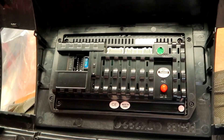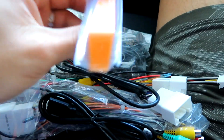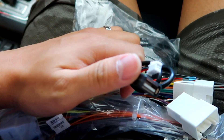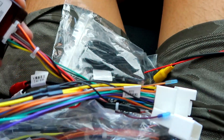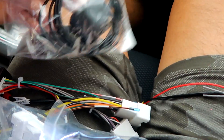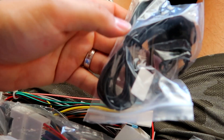Over the years I've done a bunch of these double din head unit installs, so I'm very familiar. Pretty much all the white clips, power, and all that stuff is provided — it's all pretty much plug and play, so we just have to figure out what goes where. The kit provided a lot of stuff: a pry tool, a little screwdriver, wires that plug into the head unit for Apple CarPlay, harnesses that plug into your main harness, a GPS antenna, and a little microphone.